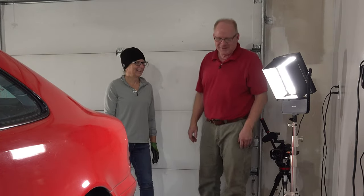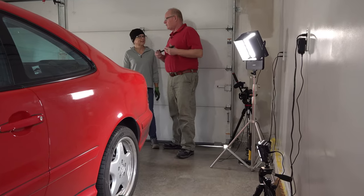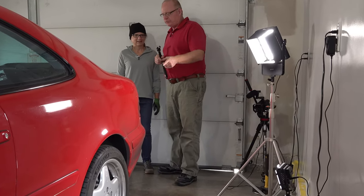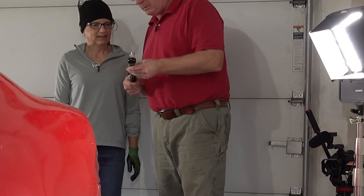You're just happy as a clam, aren't you? I'm so excited — you fixed your brakes, didn't you? I did. So Di, we've got to now tighten your wheel bolts to 120 Newton meters. Okay. This torque wrench only goes up to 108 Newton meters, so we don't have a tool that will do what we need.